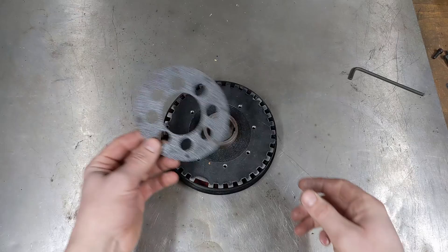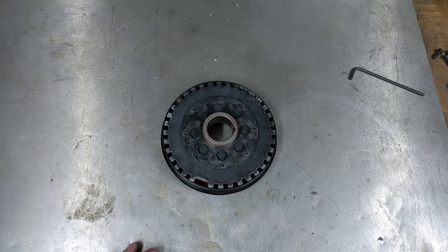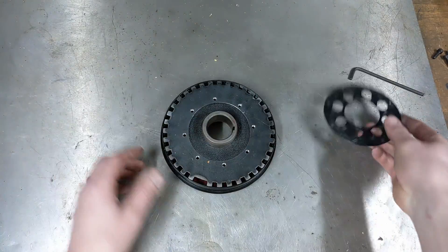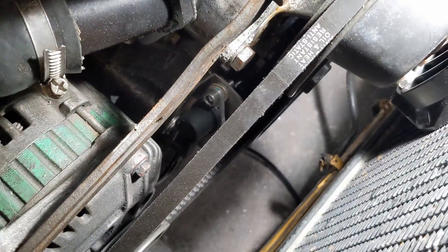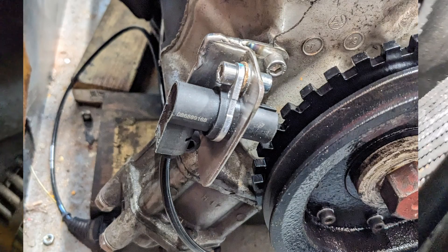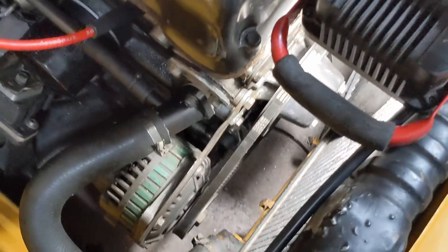Here's another guide I printed which I use to drill the initial holes. Once that was all mounted on there, I drilled the holes. Here we are a little while later - the pulley and trigger wheel now mounted to the car. I've also fabricated a little bracket on this side to mount the trigger sensor. It's an E36 Hall Effect sensor. It's nice and discreet, hidden down there near the alternator - you can't really see it unless you're looking for it.